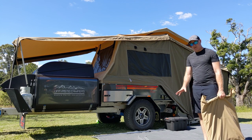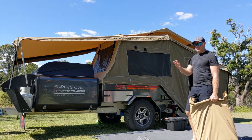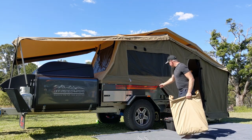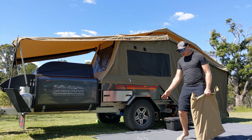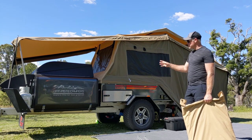I'll show you how these connect onto the trailer. Remember in a previous video we found the center latch and the most rear latch on the trailer — we push the actual latch up underneath the canvas, just exposing these two little holes: one just to the left and the other just at the back here. At the end of these poles are two 90-degree nipples that slot into these holes with little split pins. We'll put the split pin through and secure them into the holes.